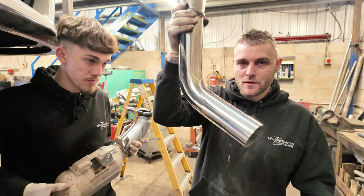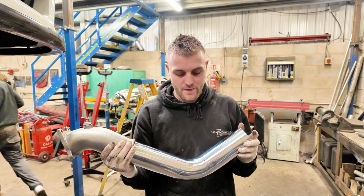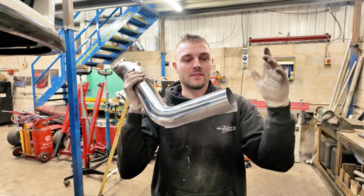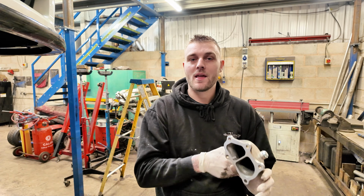So I have had to cut the back part of this downpipe off. Like I say, it doesn't fit. This is an automatic, so I am going to modify it. It will be easily modified. I'll just put a slip joint here, a little bit of a dog leg onto a bit of existing, and then that'll finish there. And all I'll do then is work from there back.